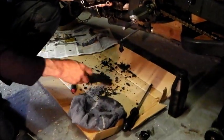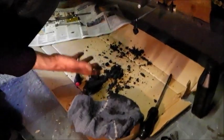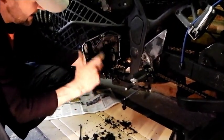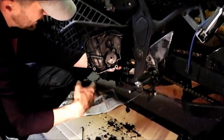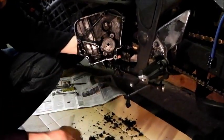That's about the contents of what was inside the casing - mostly chain lubricant, dust, debris, and sand from the road. This is what gets thrown up off your chain into this casing. That's cleaned it out. You can get some brake cleaner in there and wash it all, but it's not overly important as long as you can see and there's no excess debris. Be careful raking around with a screwdriver too much, because it's an alloy casing and there are little bits of rubber in there.